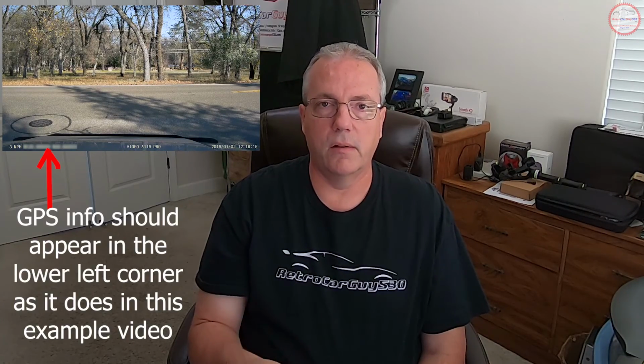This particular A119 Pro is actually the second one I've had. The first one that I received basically seemed to work. I noticed when I was viewing the video, the GPS information, which was supposed to be written to the video, wasn't there, except one time out of maybe 10 I actually saw it on the video. And when I used the Dashcam Viewer program to look at it, there was no GPS location info. So then I tried putting the A119S version 2 camera in both vehicles, and it worked 100% of the time with that one.